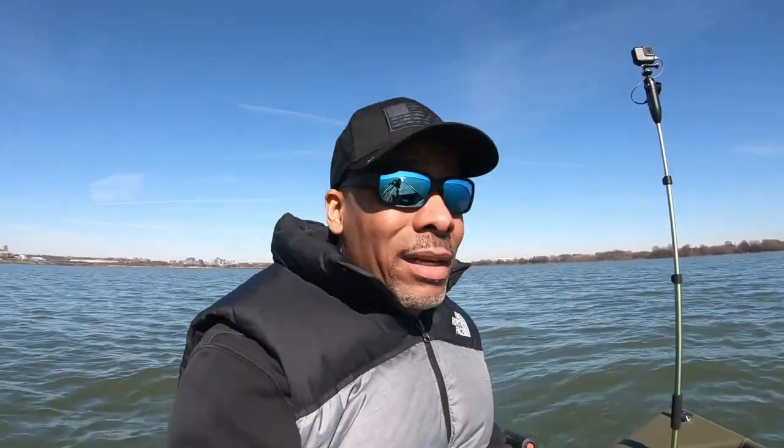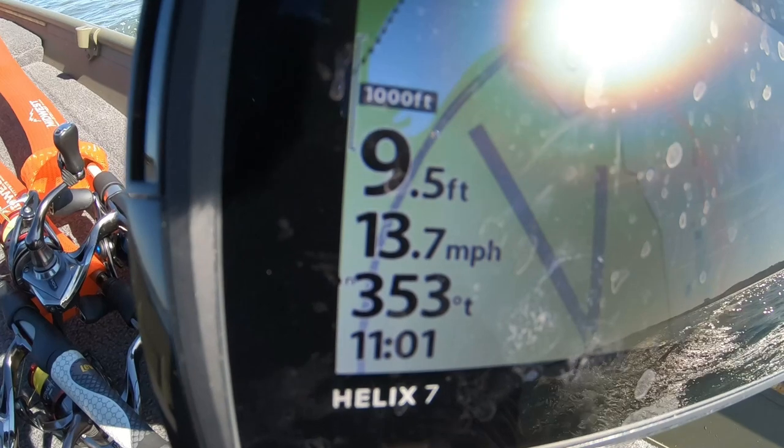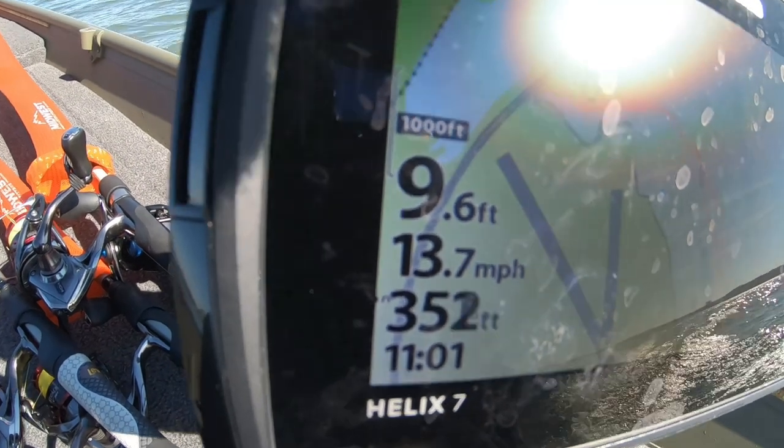I'm a little excited — I put a lot into this install. I'm going to run it around a bit more, turn off the camera, and get back to you to tell you what I did. But 12.4 is a great start. When I went back going with the wind, believe it or not I got the same miles per hour — hovering around 12.5. But when I raised the motor up about four inches, I got to over 13 miles per hour, as you can see on the graph right there, which was absolutely awesome.